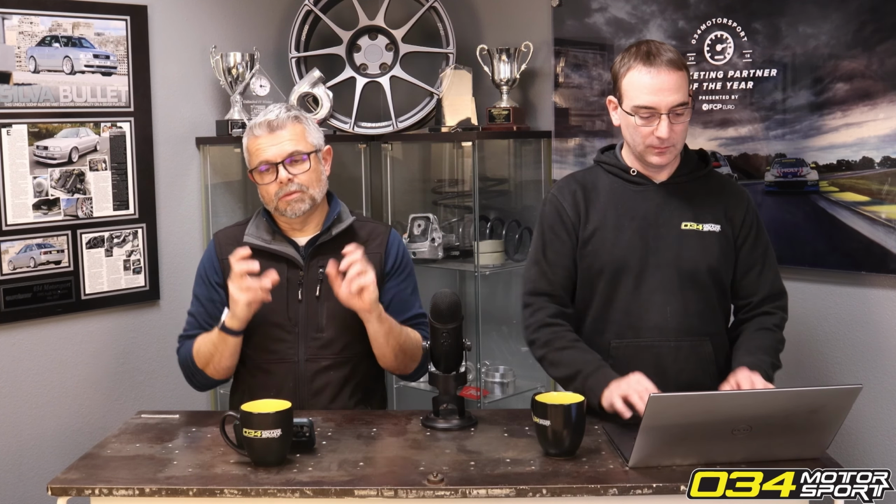The problem with this is when you tighten down the bolts, because there's so much slop around the subframe, at some point the subframe bolts will stretch and loosen, and then you get this characteristic clunking sound, especially at low speeds when you're going up over a driveway or anytime the suspension loads up.